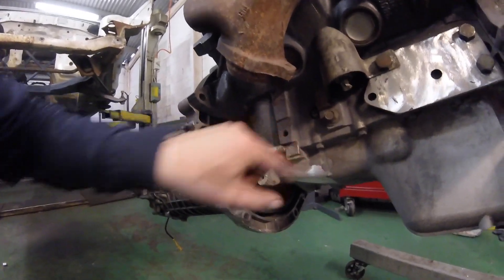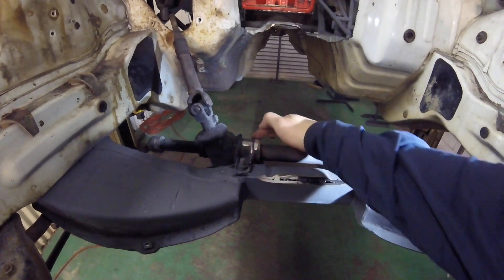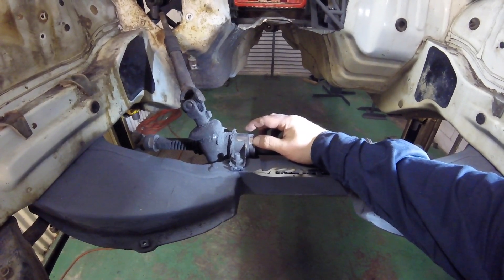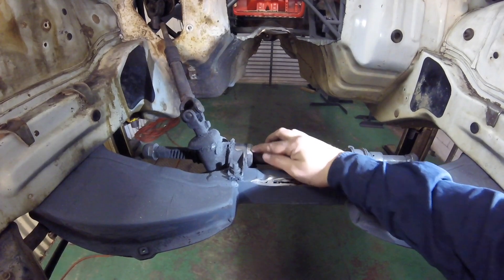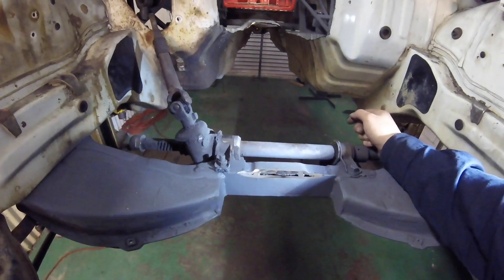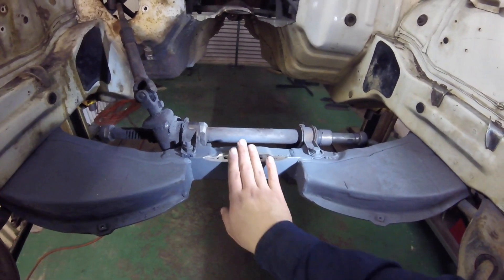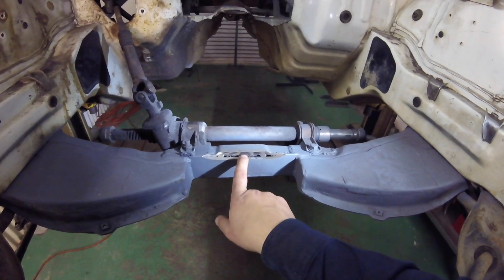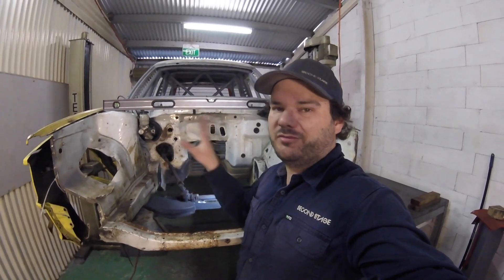Pretty major pinch point between the steering rack and the engine, which is always an issue with the Toyota steering rack. There was another one of these huge big things right exactly where the steering rack was, so obviously that's gone now. I'll just clean that up as nice as I can. So the steering rack itself - I've just ground that lip. There used to be like a lip that sits maybe 5 to 10 mil higher here, I've just ground that completely flat. Because this here is the point that causes all the issues. And then this is a little bit of an aluminium bush here that's part of the steering rack itself that makes sure it locates in exactly the right spot - I've just taken the top off of that and gave it a bit of a chamfer. And then I had quite a really square corner here as well where I'd modified the cross member, and I've just given myself a nice 45 degree bevel - that was a point that was touching. I've also adjusted the feet on the hoist to make sure that I'm level both side to side and back to front. There's a little bit of fussing about to get it right, but I'm reasonably happy where I am now.